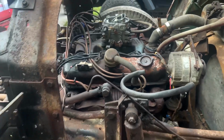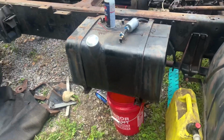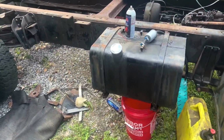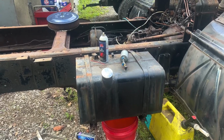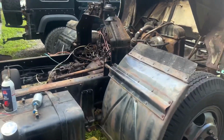Tried to prime it on both sides and it wouldn't take fuel. I cleaned the tank out, put a bunch of diesel in it, let it kind of do its thing. Went in there with, I think, that piece of random brake line or whatever that is, tried to clean it out. Didn't really do the best, but it's better than not doing anything. Put 5 gallons of fresh gas in it, and yeah, didn't want to take it, so went and picked up a pump.